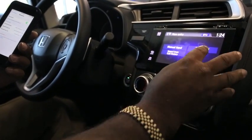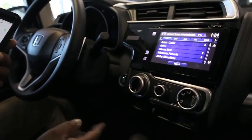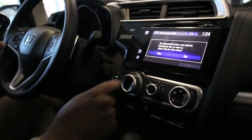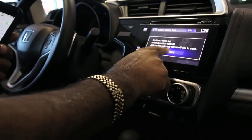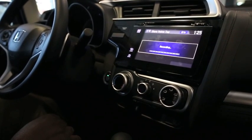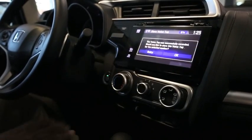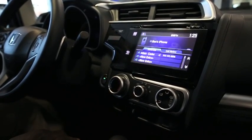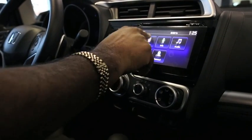I'm going to import a contact from my phone book. I touch that name coming up, and I'm going to put the first one in here just to show you how it's done. I tap it, select that I want to speed dial on it, and tap 'Yes.' I record — 'Adam Cater' — okay, it was successfully recorded. I tap that, it's ready, I hit 'OK,' and it's in there.